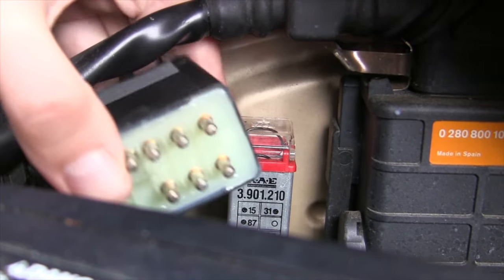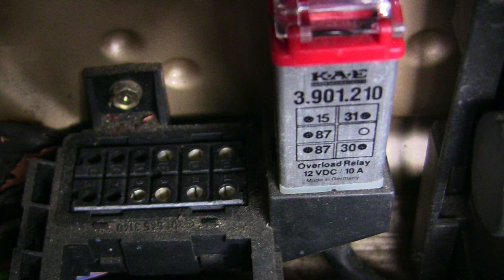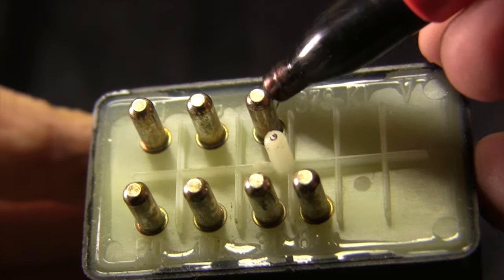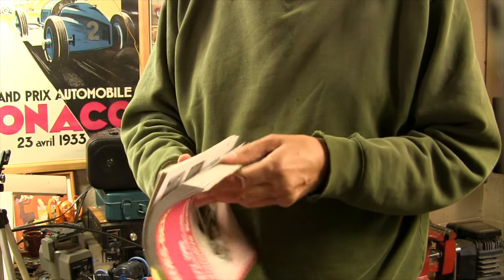It's situated right next to the over-voltage protection relay. Grip it by the sides and gently wiggle it straight upwards and pull it out. It plugs in by two rows of pins, and it is these pins that are going to help us find out if what's inside has gone bad — by jumpering across two of the pins we are going to bypass some internal components.